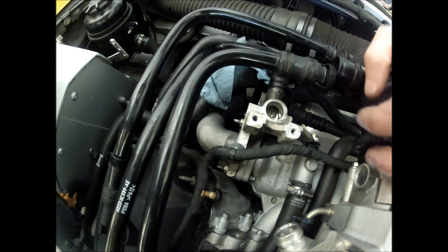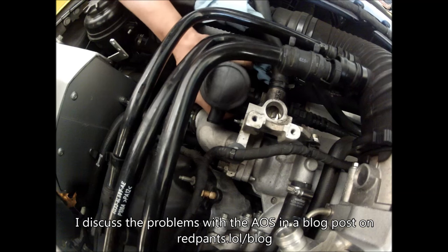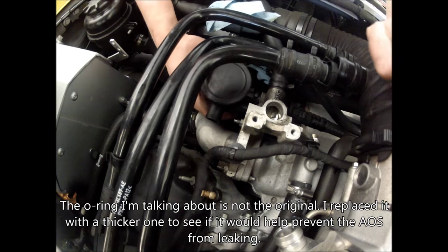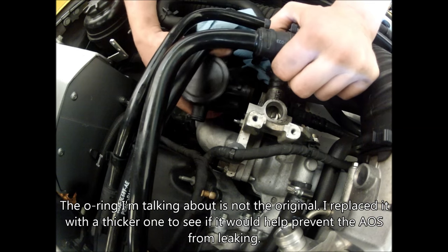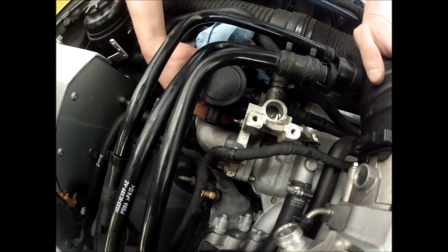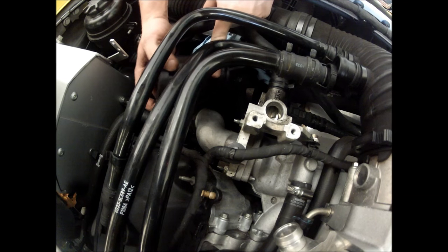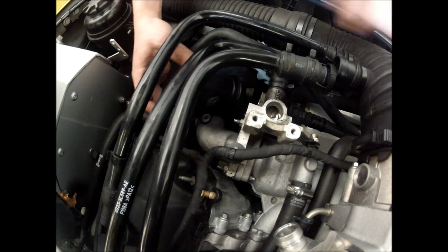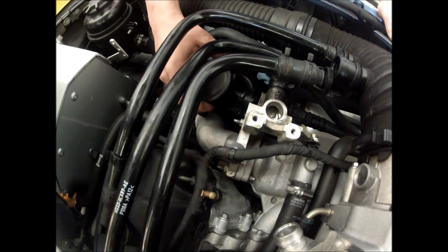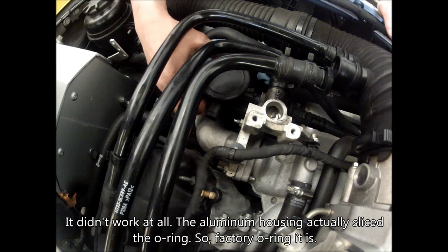The AOS plugs in right here and just pops in. I put a new O-ring on this and it seems to be fighting me, so I'll probably have to swap it for another one. This O-ring tends to let some oil get by because you only have one bolt holding this whole thing in place — it doesn't have positive pressure on both sides. Over time with engine vibration and heat cycling it starts letting oil through. If you have oil, grime, and dirt caked on here and on the hose that comes out the bottom, that's what it's from. You can replace the O-ring with a factory-spec one for less than a dollar.